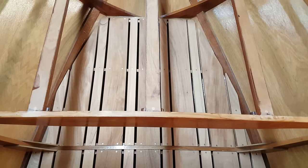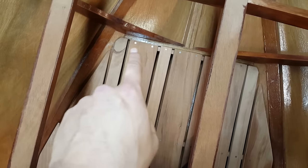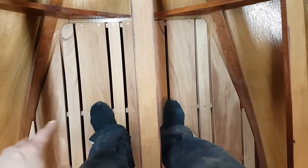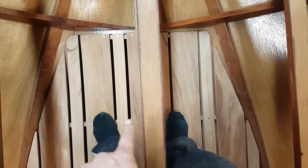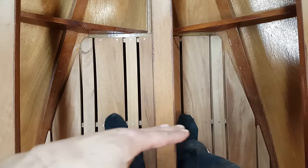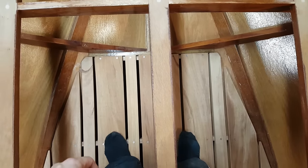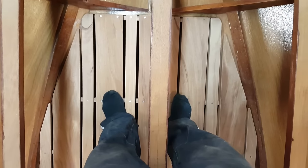Let's step in there and test it. I'm standing on it — out in the very middle. It's about 32 inches from floor timber five and a half back to frame four. So 200 pounds in two spots, spanning probably four of these boards. If it can support me at 200 pounds out in the very center, it's going to support a full fuel tank at maybe 120 pounds slid up against that frame with ease. I'm really not worried about bracing this at all.